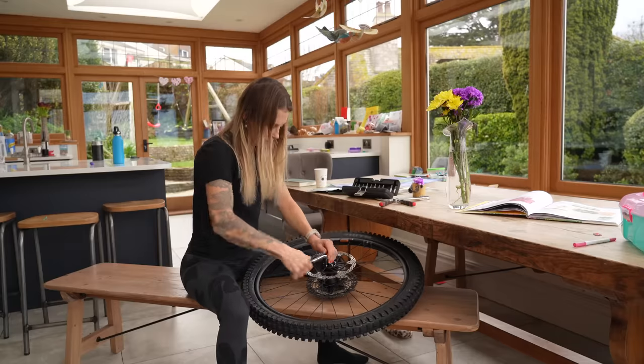It's quite tricky to show you, but you see the silver bolts - they stick out more than the rotor so it just slightly catches there on the edge of the brake mount. I'm a bit bummed that I didn't know that this was an issue with these rotors. I did buy these from my local bike shop - might have been nice if they'd mentioned it or asked me what fork I was running, because it's not just the Fox that this is an issue with, it's also the same with RockShox. I don't feel super confident having to file that bit down. I'll see if I've got a suitable file; if not I'm just going to put everything else on and then nip around to my friend Dan's house to do that final bit of work there, so I have more peace of mind that I'm not going to mess it up - it's irreversible after all.